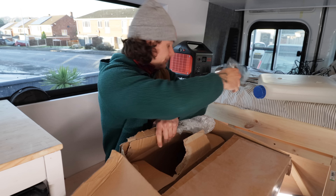Slot this fuse in to complete the circuit and our control panel light — there we go, that comes on. I'm just going to quickly Google how to prime the circuit because I've done it before but I can't remember. So what we've got to do is press OK and down together. That'll come up with H off, you now got to press it up to H on. And there's your fuel pump — can you hear it in the background? That's just initiated and that's bringing fuel through the line. There she is — look, there's the fuel coming down the line. You can see that now it's filling up the fuel filter.